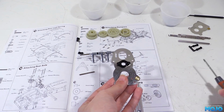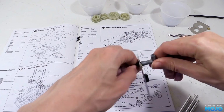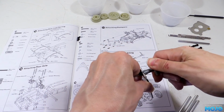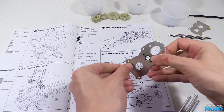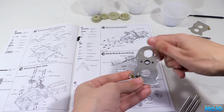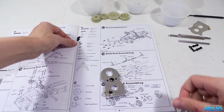Next we've got the short rod with the thread at one end, and unfortunately it looks like I missed the record button, so all we get to see is the final tightening. The rod is there for a widget to run on that keeps the shift rod from turning too much. It's really not all that critical how it's installed. As long as most of the thread is covered by the 2 flange nuts, it'll work just fine.